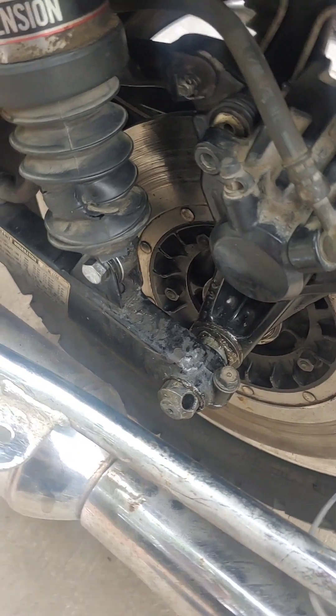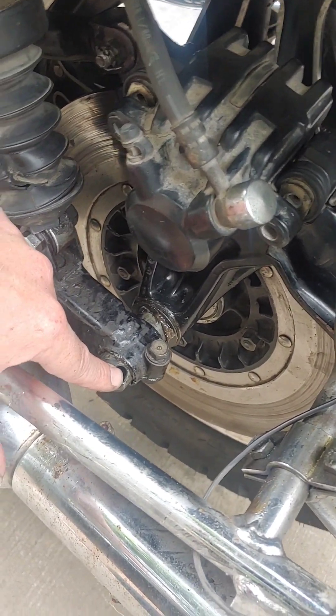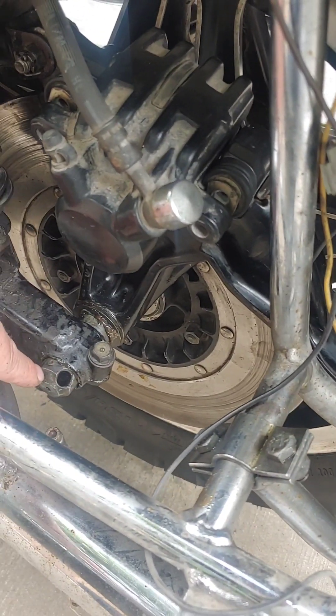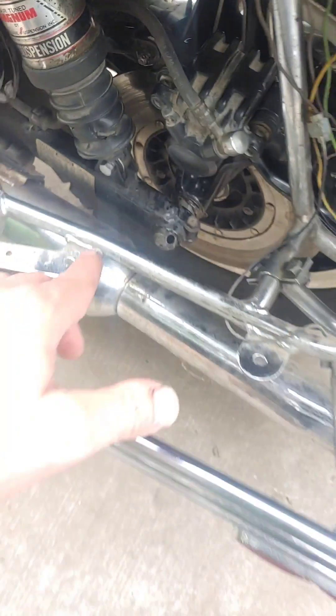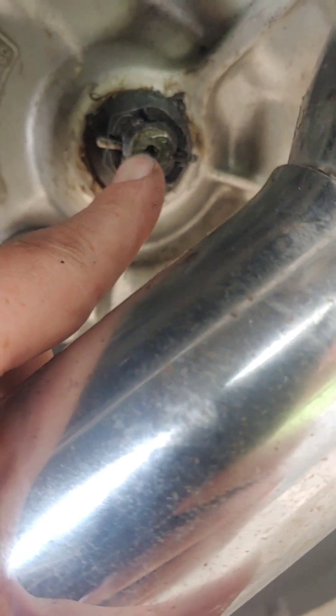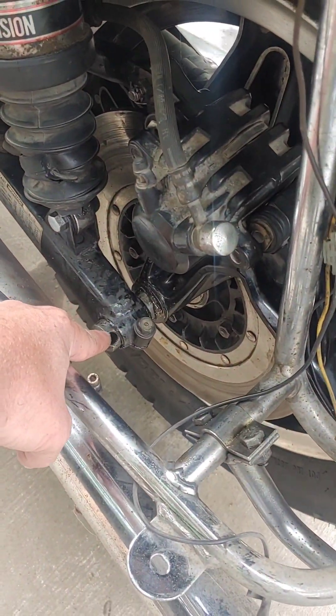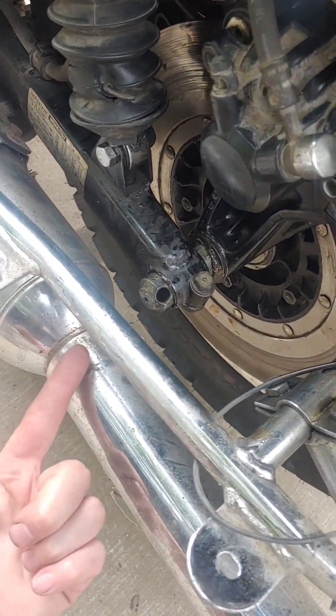That'll come right up. Then get yourself a big screwdriver and spin this axle. What I also do is take a hammer — like a 16 ounce — and put it in the hole of the center of the axle right there. A Phillips screwdriver will go right in there and I'll tap on it gently. Usually between giving that a little tap to break it loose and sticking the screwdriver in this hole on the other side, I can pull that right out.